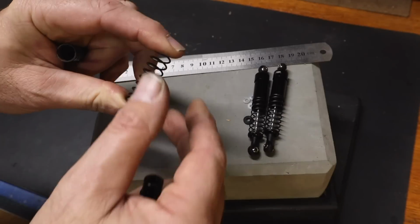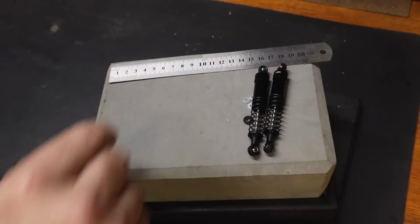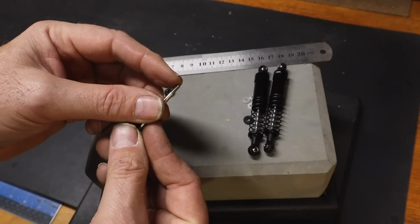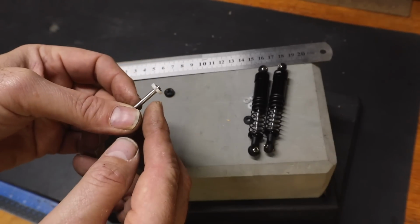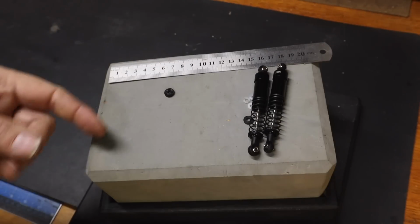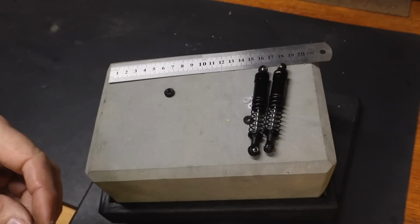There it is. Yeah. None of us are using a 7-pound spring. But as I just mentioned, you can put that piston in, because the shaft is reduced to 3 millimeter at the bottom. It is also reduced to 3 millimeter where the piston slides on, which means any 10 millimeter piston goes right in. So old Associated will fit in there. Traxxas will fit in there. Anybody that's right about 10, and you've got a little room for error because it's actually a 10.2 millimeter bore.